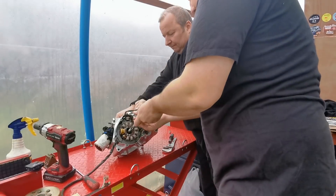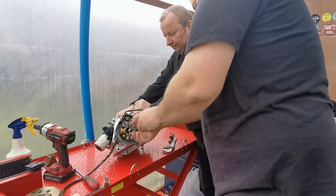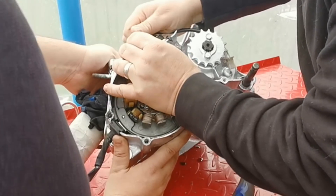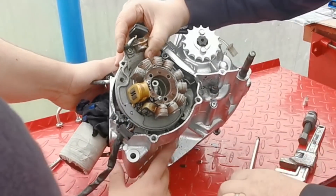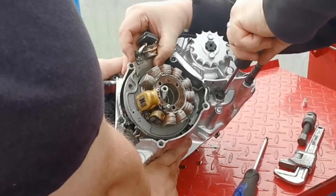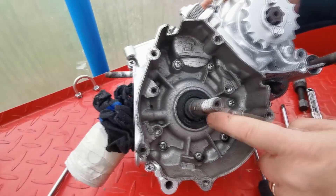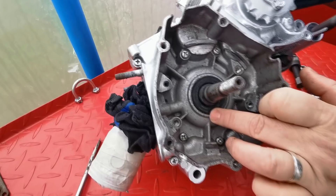Can you just hold that wire? We might need to pull that rubber out of there. We've got to take the trigger off separately - not sure yet. There we go, that should lift forward. Get that one out for the wiring loop. We've also got the little neutral switch there as well - another JIS screw on that, just a half a turn. It's a little slotted pump lug on there which you pull out, and that should all lift out together.